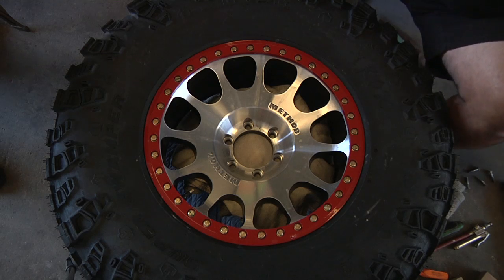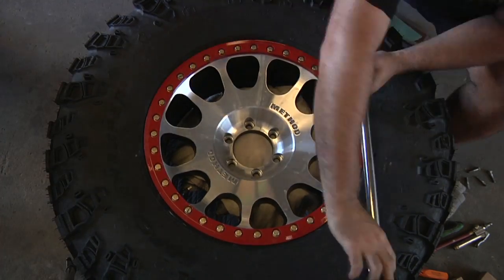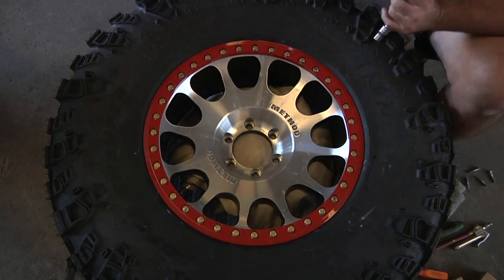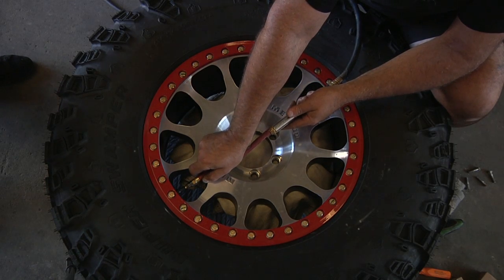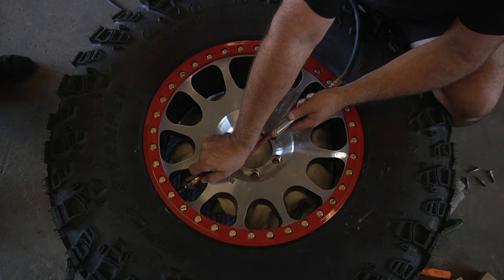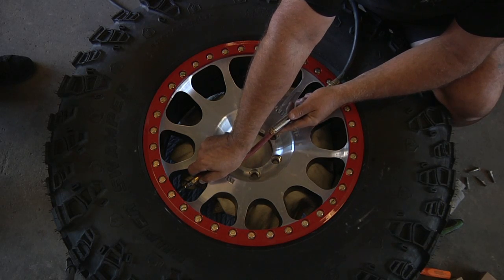Now we've got all that done — we can break out the torque wrench and do the same exact thing and just torque them down. Make sure you keep your fingers and toes out from underneath the back of this thing when the bead sets. We're setting the bead on the back side of the wheel — we've got it locked up here, we've got to set the back side. Just tell when the bead pops, you'll hear it. We're running about 25 pounds of air and that's about all we need for these, for now, until we get them on the car and see where they're at.